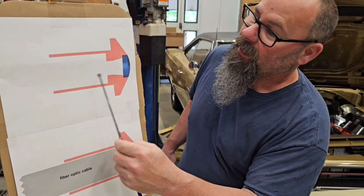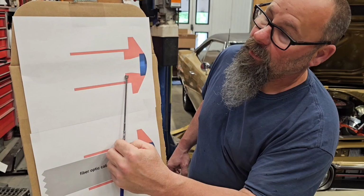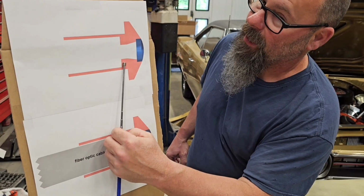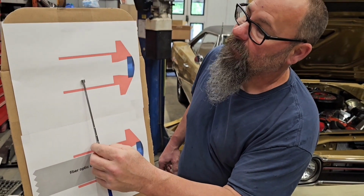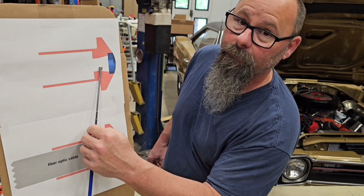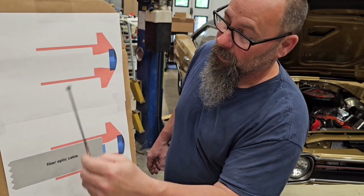optical lens. Now, installing that fiber optics not fully ½ inch into the housing, so the black jacket of the fiber optics hits this back edge, will cause issues with light display. And the reason for that is because the light will reflect off the inner housing before it gets choked into the light chamber. Okay, so there's a specific installation for that I want to go over.